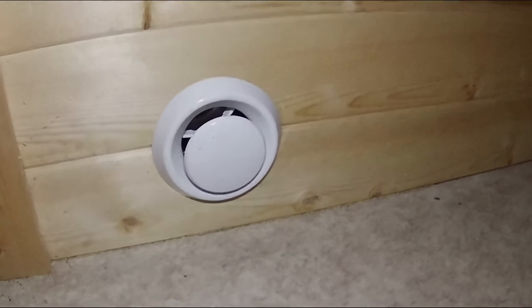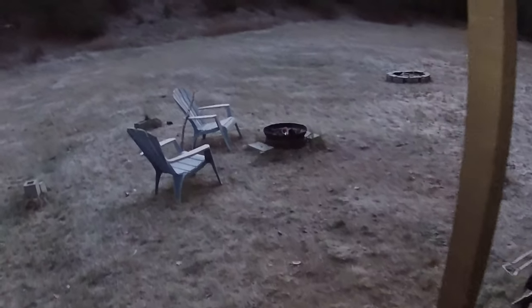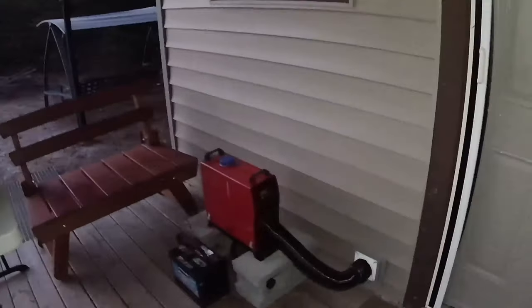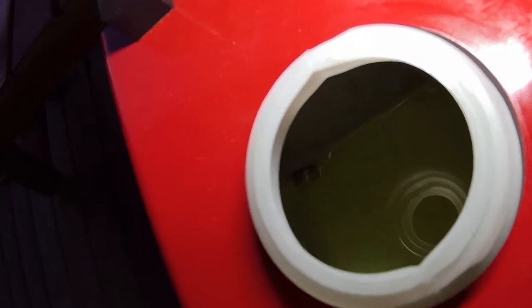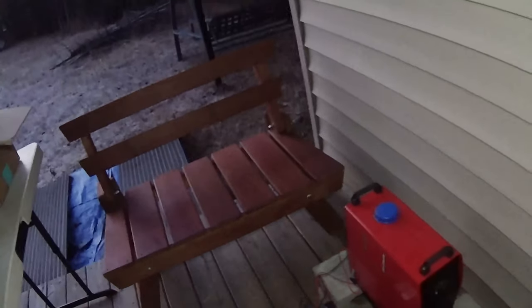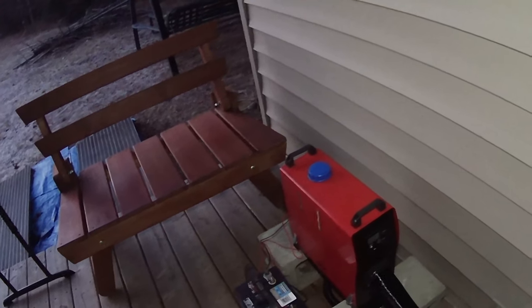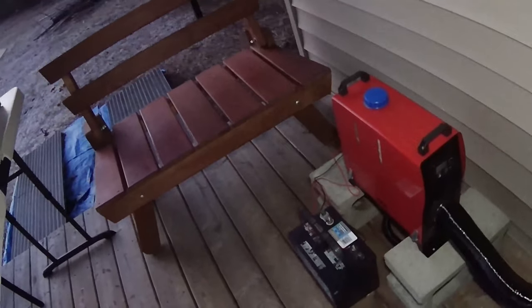Hope this thing will stay running throughout the night with no issues — we'll come back in the morning and let you know how it went. All right, you can see it's pretty cold out here today. The ground is frozen and the heater is not running. Now it's plenty warm in the cabin, but at about 4:30 this morning, which was about 12 and a half hours after initially turning it on, it turned off. We still have diesel in there, but there's a sensor right there in the left-hand corner that is exposed, which is why the diesel heater turned off. We ran through about four and a half liters or so of diesel and it kept it nice and toasty in there last night. So I'm going to get some more diesel, fire it back up, and I'm sure it's going to be just fine.